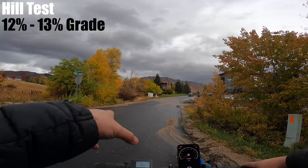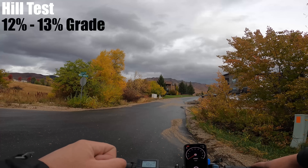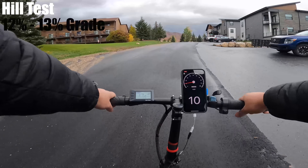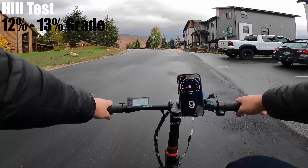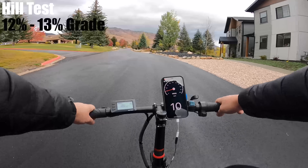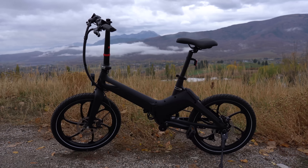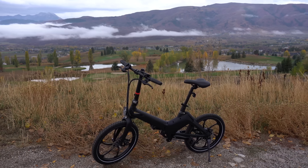This is the hill test. It's the same hill I've used the past 4 or 5 videos — about 2 blocks long, 12 to 13% grade at the steepest. I'm on pedal assist level 3 with a full battery in first gear. Right where it starts to climb, it's holding at 10, down to 9, holding at 9 — that's got some pretty good power — back up to 10, and coming over the top. The F1 is average for hill climbing power for this range. It can tackle some steep hills; just make sure to have it on a medium gear and help it climb to conserve battery life. I'm thinking 15 to 20% is about the steepest you'll be able to go if you're close to my weight of 185 pounds.